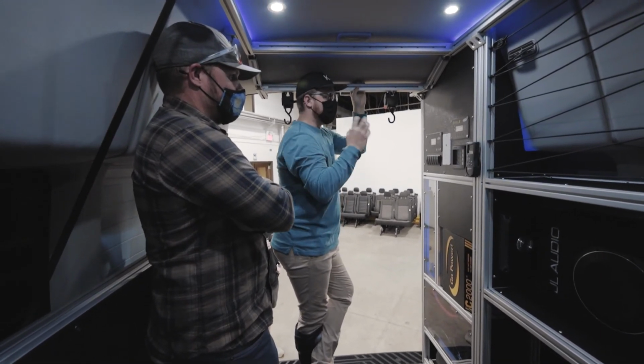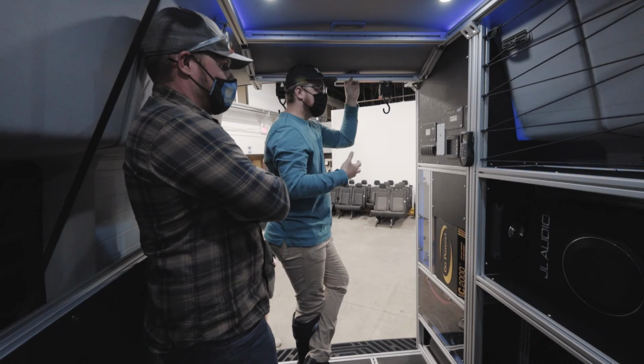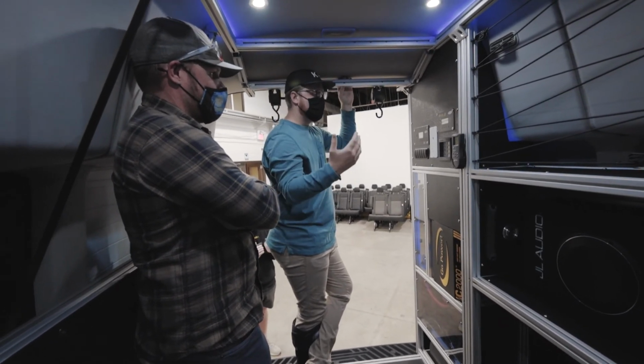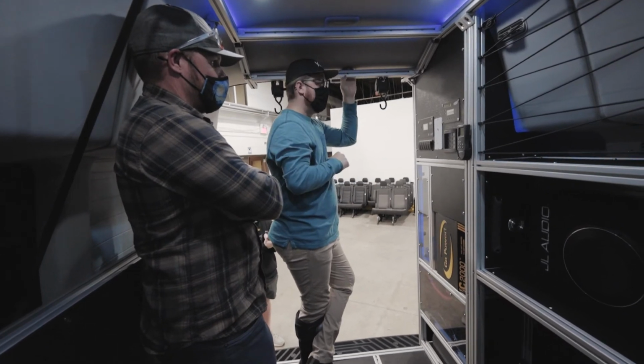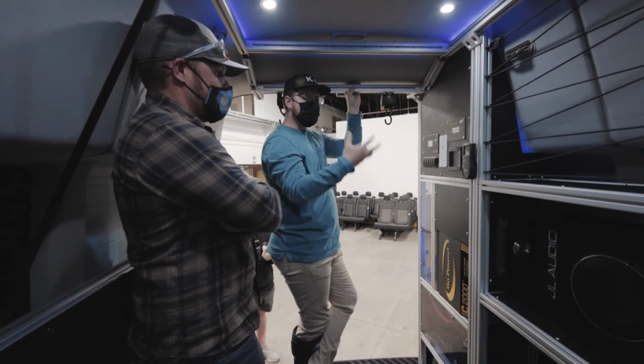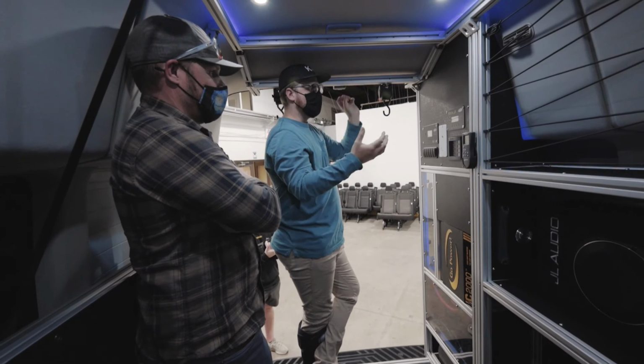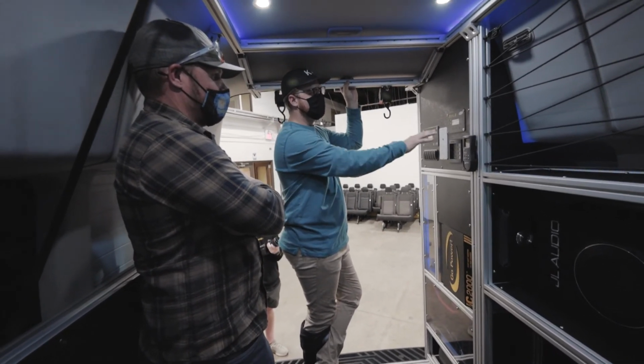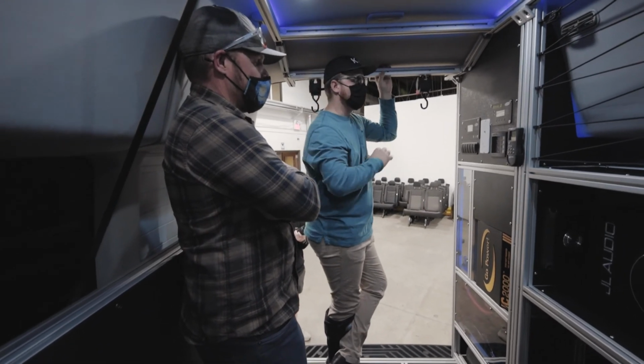Even if you plugged into a 30 amp service at a campsite, which is pretty common, since everyone's campsites are wired different, maybe sometimes the 15's tripping pretty easy for you, or they don't have one, you can use an adapter to change the plug from a 30 to a 15. We're still limiting what's coming into the van, so there's no issues there.